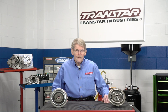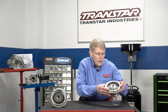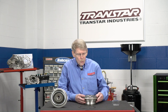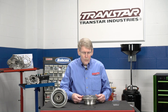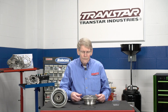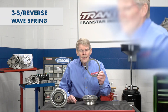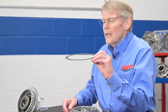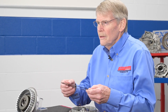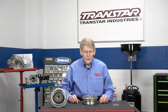Both of these clutch packs are contained in the same housing. The number one problem that General Motors had, not only on the 6T40 but on the 6T70, when it comes to the rotating housing is the 3-5 reverse wave spring. These wave springs are notorious for breaking and they have been updated to a better material, hopefully one that works long term.